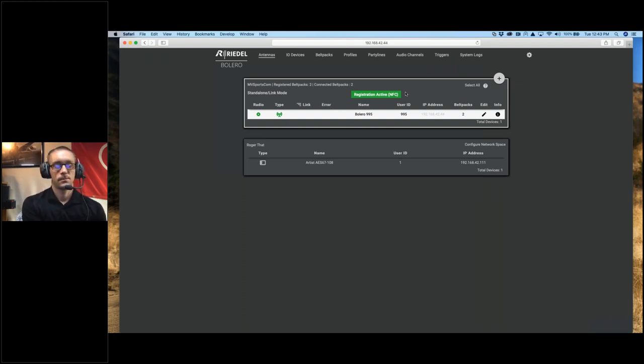Apparently, David had said that network cards use DHCP, and the question is, when would network cards use DHCP? When you want to use a DHCP server, that's more of networking, guys. Sometimes somebody wants a static IP address and they want to have control of their ARP tables and those kinds of things and set those things up in their switches. And that goes to really advanced networking stuff where you really set up your DHCP server.